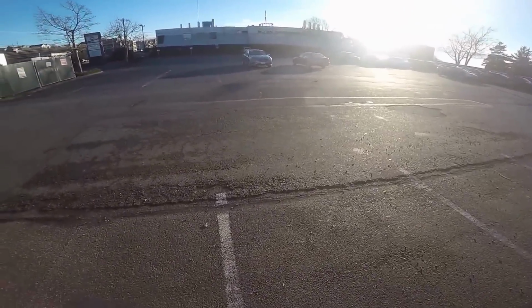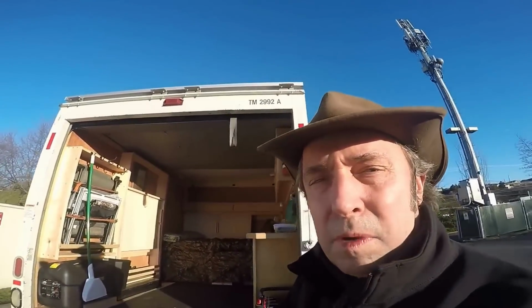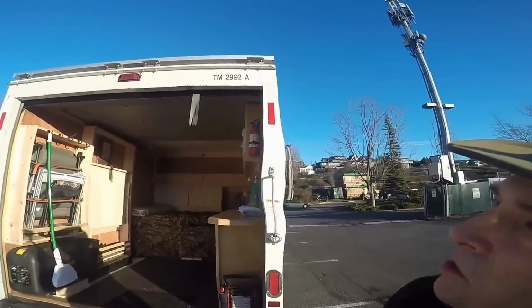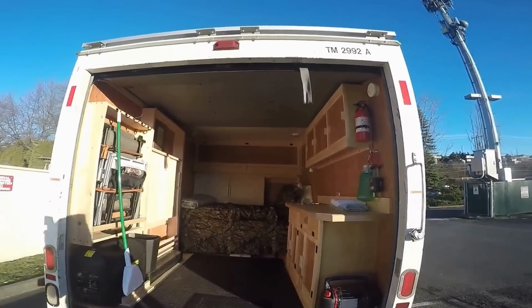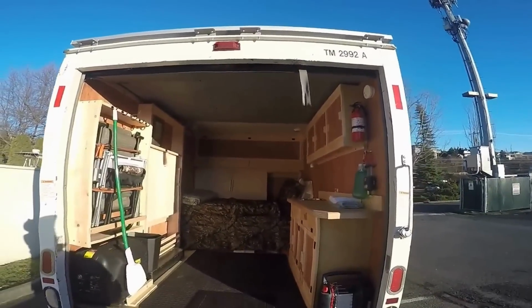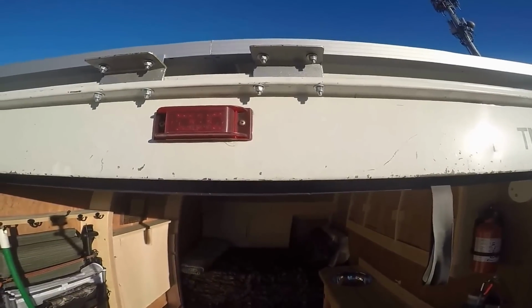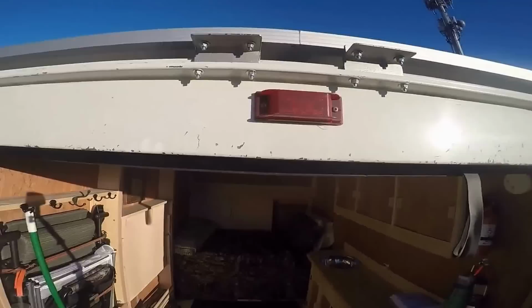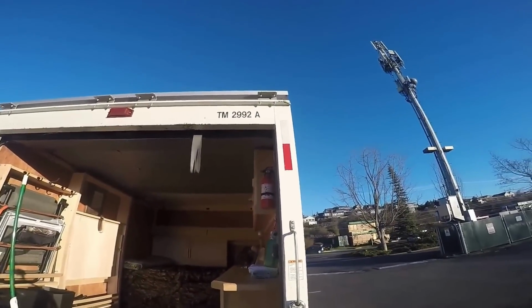Okay, I couldn't talk into the camera while I was holding it up there, but those are actually two 150 watt monocrystalline solar panels, and you'll notice it's really worked out great because those two panels fit just perfectly dimension-wise across the back end of the van. And I had to sort of fabricate some brackets right there to bolt them on the back.